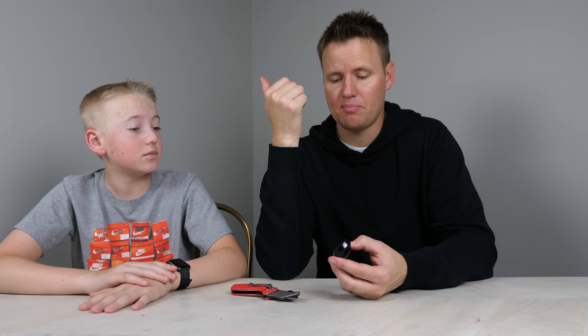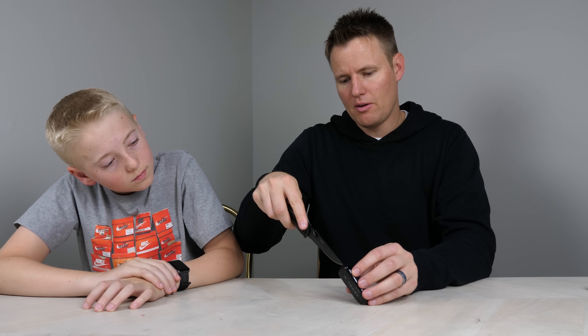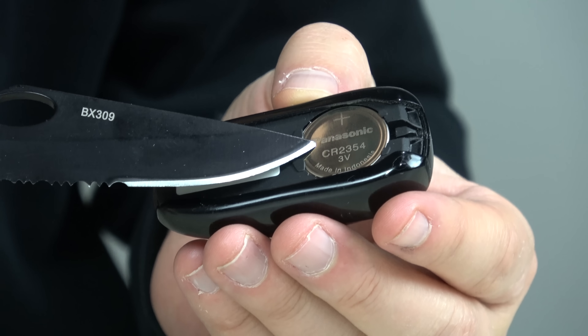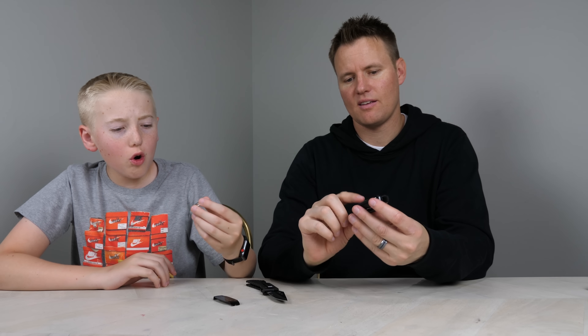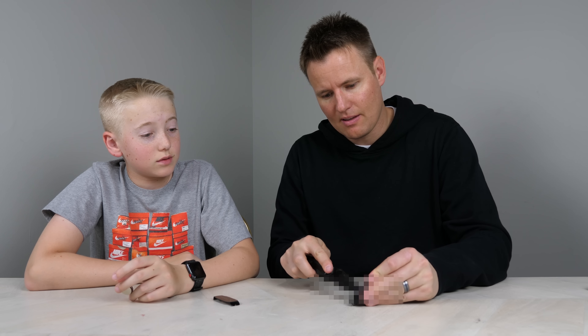One problem I've had with this key is that if you leave it in your car overnight in the garage, the car is constantly pinging the key and the battery dies every couple of months. You put the blade right under the back and just pop it off — like it's hot. Inside you've got the CR2354 battery. I went to many grocery stores and battery stores and they didn't have it, so it's a little tricky to get. Look how thick that battery is. There's also the key fob data sticker, but we'll blur that out because someone could use that number to program a new key to our car.